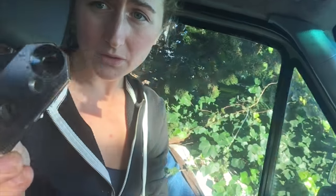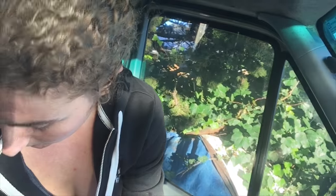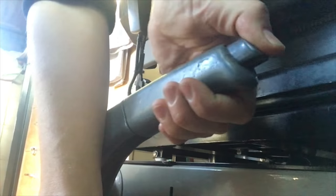If you do install this little bracket, they recommend that you tighten the brake cables — the emergency brake — and there is a way to do this. They include it in the instructions: you can go under the van and tighten the brake cables, then you can engage the swivel and pull the brake at the same time. If you look at my brake right now, when I pull it it's really high up — it's engaged. If I tighten those cables, I can have it pulled up to here instead of here.